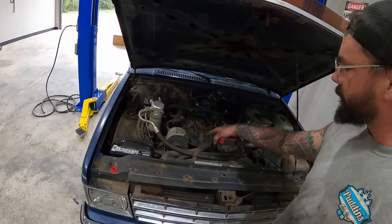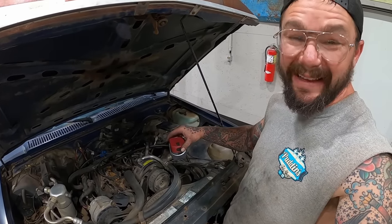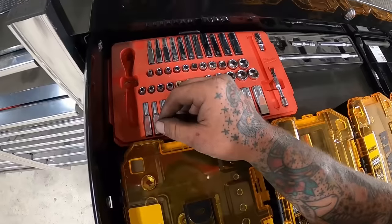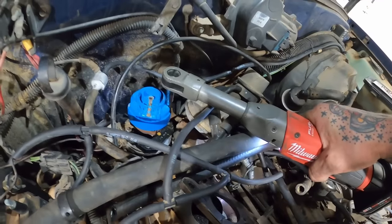1, 2, 3. New spark plugs in that side. They all went right in, no problemo. Distributor cap will not be in till tomorrow at noon. But we can still go ahead and pop on our new rotor. Look at them little baby screws. What size y'all reckon those are? Looks smaller than a quarter inch to me. Might be the good old metric system. 7/32 is gonna work.